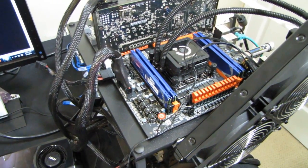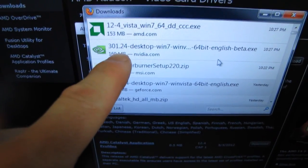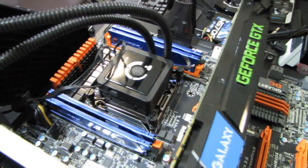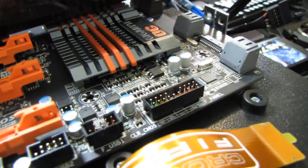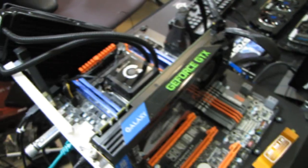A couple of critical details: test benches and driver revisions. For the GTX 670 I'm using the publicly available beta driver 301.34, for other Nvidia cards I'm using 301.24, and for all AMD cards the latest 12.4 drivers. My test bench is a 4.4 GHz Intel 3930K with 16 gigs of Kingston HyperX DDR3-1600 RAM, a Gigabyte X79 UD7 motherboard supporting up to four GPUs in SLI or CrossFire, a Chronos Deluxe 120 GB boot drive, and an OCZ ZX 1250-watt 80 Plus Gold power supply.